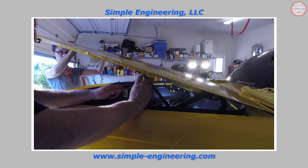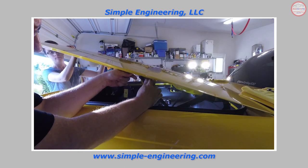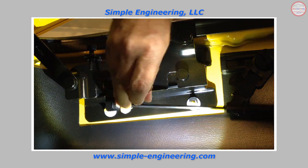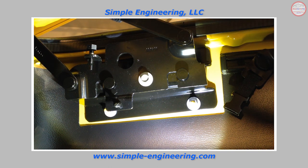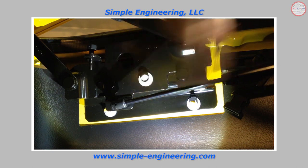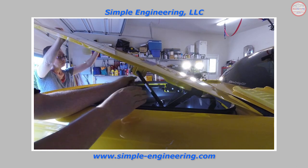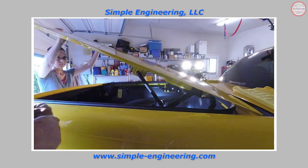Now I'm going to remove the top side of this strut on the passenger side — are you ready for the additional weight? Put the screwdriver underneath. Now I'm pulling the bottom ball off — it's a little more resistant than I'd like, so let's remove that clip. And that's off. Now we're going to install the new strut on the bottom side — let's push that on and snap it up. It's securely on. If you would please elevate the cargo cover — I need a little more height — right there, perfect. The top side on the passenger side is now engaged and I can't pull it off. Same with the bottom side. Passenger side complete.